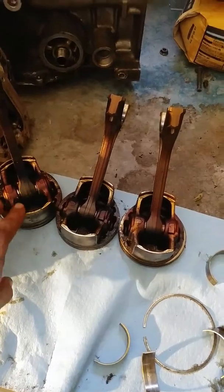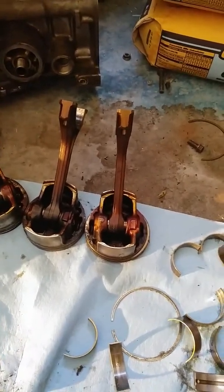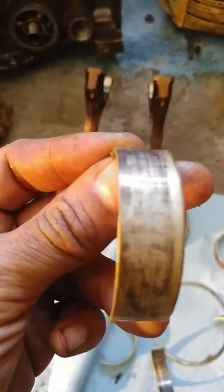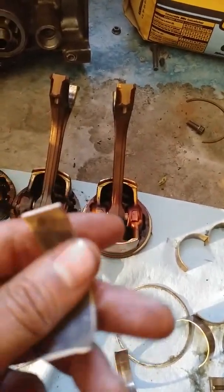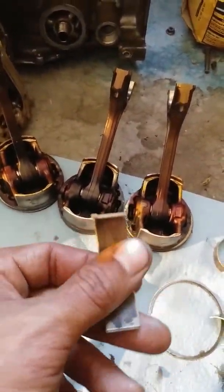We're going to micro polish the crank. We're not going to reuse these pistons because I believe these are low compression pistons — like 9.9 to 1, or maybe 9.7 to 1, something like that. Here's the rod bearing — you can see it's not too bad, just a little bit scarred up here and there. I'm not going to reuse them at all, just wanted to see how badly the motor wore.